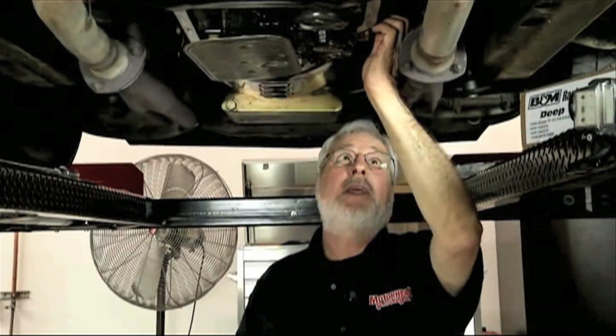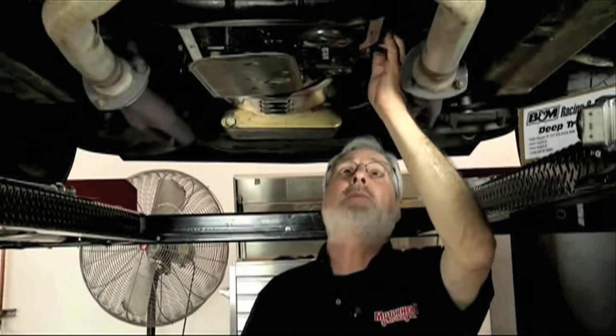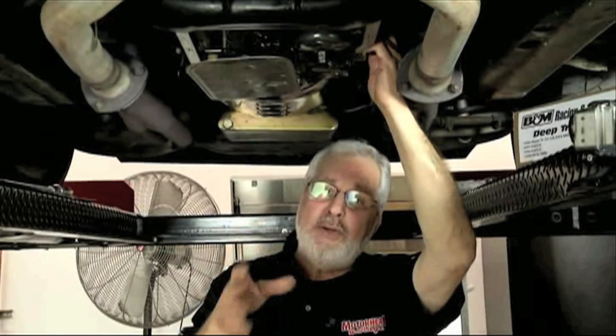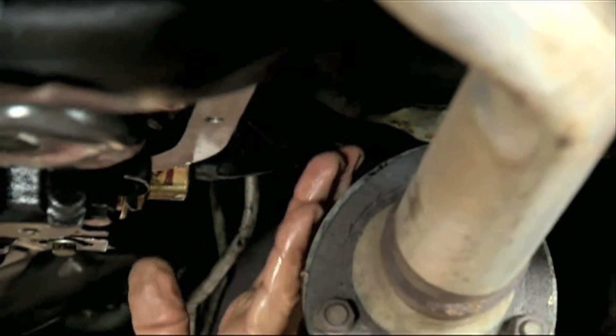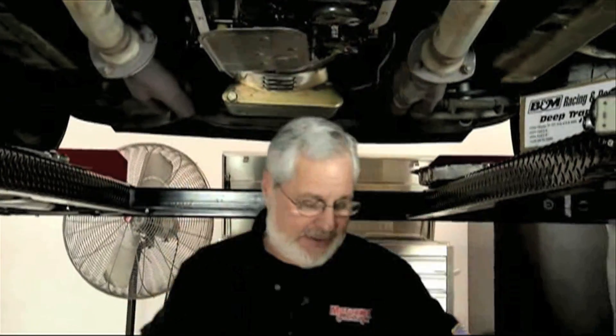If you can find a little piece of silicone tubing down here because you're near the headers, that would be good. Here's a tip: if you're using transmission fluid and you don't have a leak, pull the line off the modulator. If any fluid drips in there, the modulator's diaphragm is bad. It'll go into the intake manifold — it makes a great top cylinder lube, but you'll never see it coming out the tailpipe.